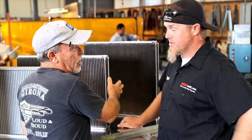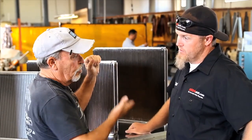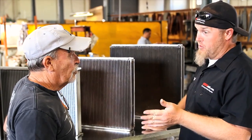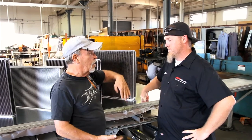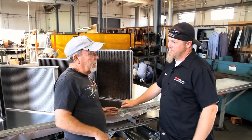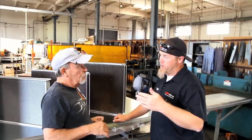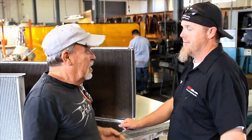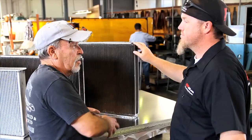Water pump manufacturers will tell you the more flow you push through an engine the cooler it'll run — not so. You get it out of the engine, but then what do you do with it? You have to run it through the radiator and the radiator has to be able to drop that temperature. If it goes through too fast you're not going to see any temperature drop. If you go with a high performance water pump that flows more water, you need a radiator that can handle that or you're just spinning your wheels. Pushing water through too fast means it doesn't have time for the same temperature drop. But going too slow is also a problem — that temperature curve will continue to rise because the water is staying in the block longer and pulling more heat. It's a double-edged sword.